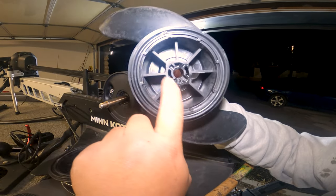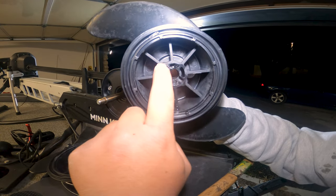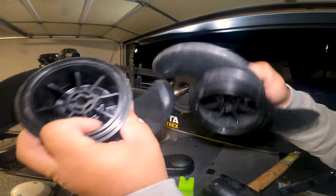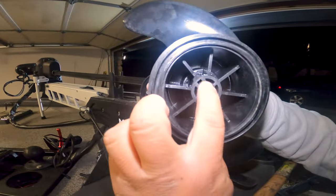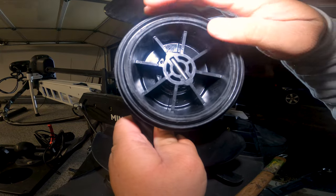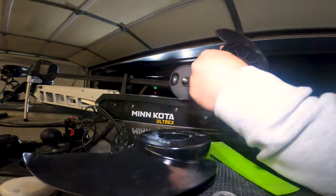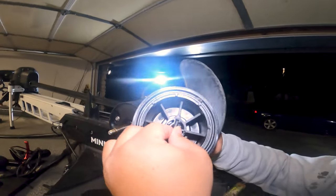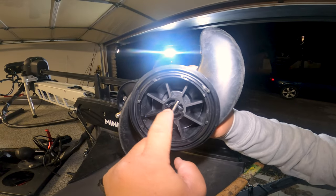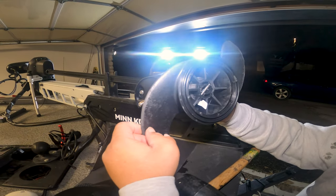See how this one, the pin's supposed to go this way, but we've broken two walls? And now the pin is kind of wobbling in here. If you look at the new one, see how it's well defined like that? This pin's supposed to just sit like this. On this one, it sat like that at one time, but it already broke through that wall and now it's sitting this way. So hopefully that's the reason why this thing is wobbling real bad.